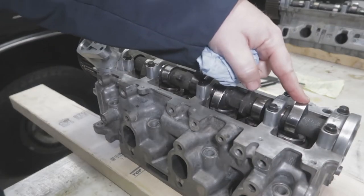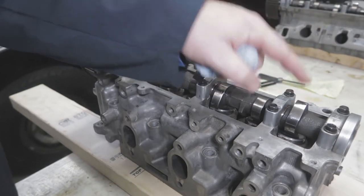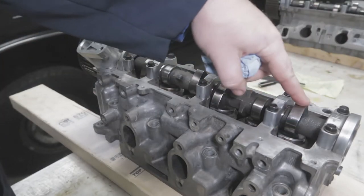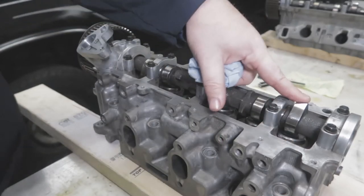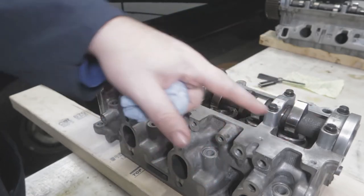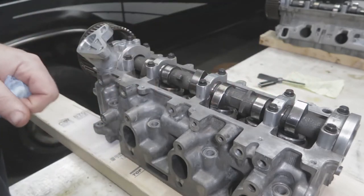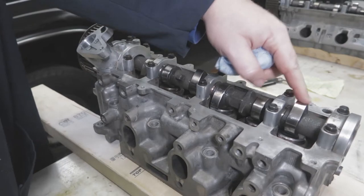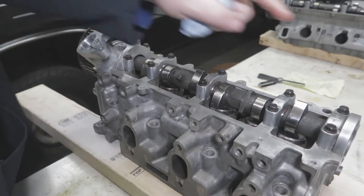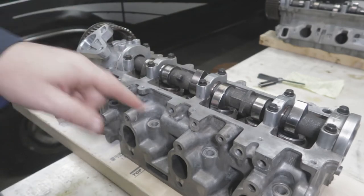The last valve I did was the one that was bent, and to get the valve to seal I had to take a lot of material off the valve seat. I knew that that would raise this follower up quite a bit. I tried this last night just playing around and thought that nothing fit in there, but I was able to sneak the one and a half thou in there — so there is a gap. I was able to measure it and it doesn't get to two thou, but it is one and a half thou. I thought I was going to have to come up with a different way to measure that one since they were already touching, but it looks like there's a gap and doing a calculation will work for that one. Now that this head is done we're going to switch it out for the other one and do the same process.